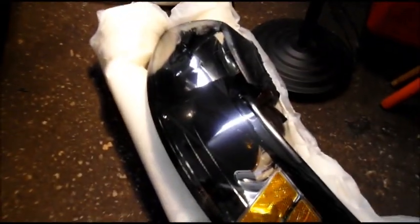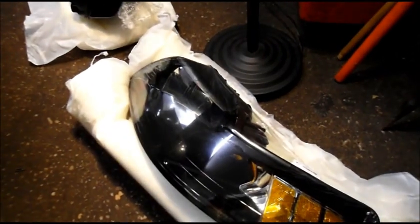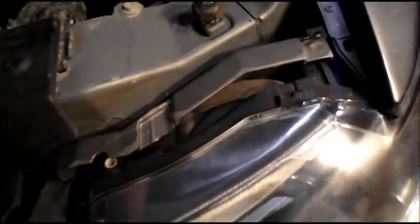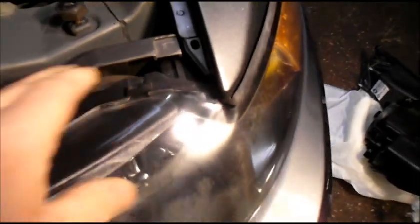As you can see, the headlights themselves get that film over the top like that. These are the replacement headlights — they do have a little plastic cover over the top to protect them. I'm going to show you how to take this light out and put them back in. Very simply, you come up underneath here, take these clips, pull this out, come over here, pull this out, and then the headlight assembly is loose.